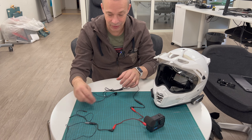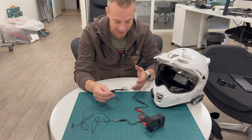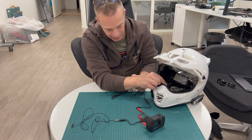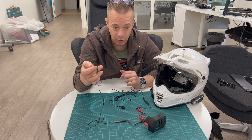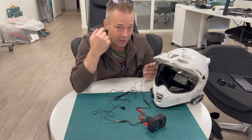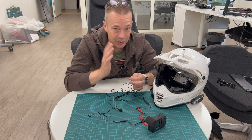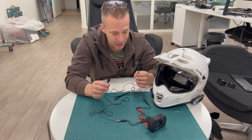The trick of course is we have to install it in the helmet. The shorter microphone cables you can get, the better - this cheap one I couldn't get shorter, it's quite a long cable so I have to bundle it up, but it disappears quite well in the helmet. This one goes inside here close to my mouth, and this one goes just on top of a speaker in the helmet to record whatever is coming through the speakerphone. I've taken the soft parts off here because it won't have any wind exposure and it becomes smaller so you can't really feel it.